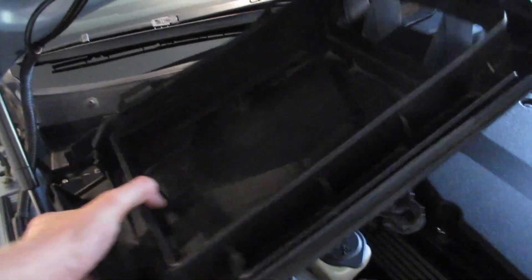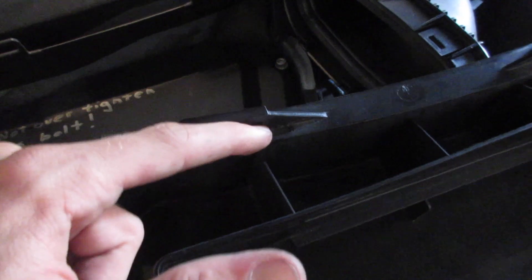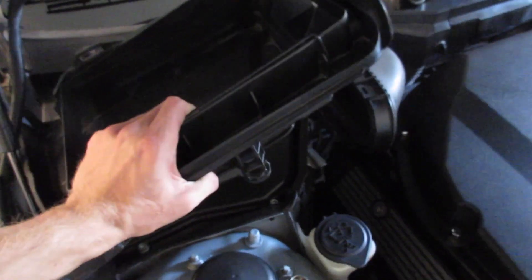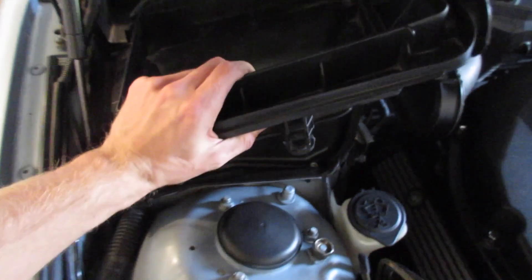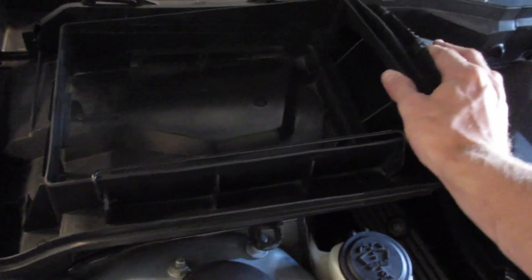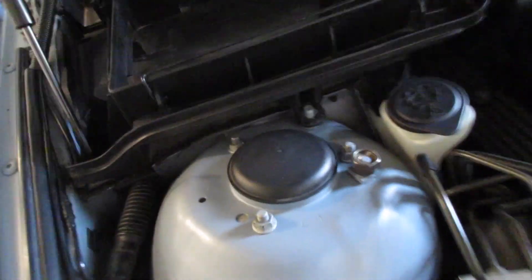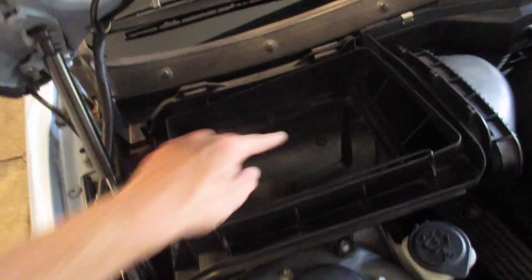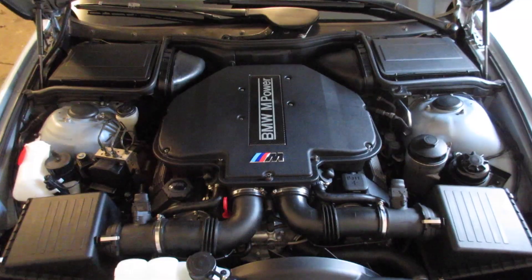It's a good time to clean all this stuff. Putting this on is what people have issues with, but we want to start with the back left corner closest to the passenger side mirror. It's got this lip on it right here that needs to go behind this lip right here. These are also the hinges for the lid of this box and they fit up in these slats — one there and one there. It sandwiches inside. Push it back in the corner, get it sandwiched back there, and then it's going to hook over that peg on the strut tower. Then just line that up, snap it on top, replace the filter, replace the clip, and finally the lid. Here is your finished product.